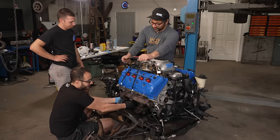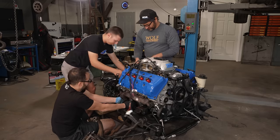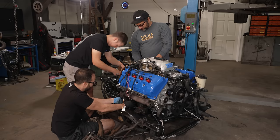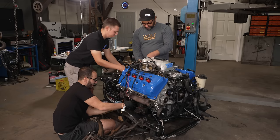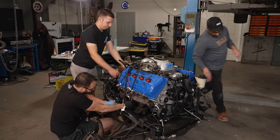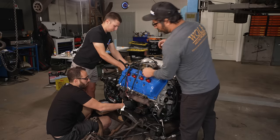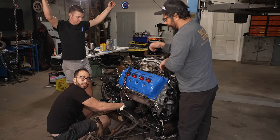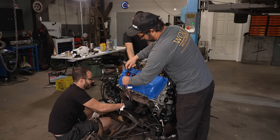So fun fact about four valve starters, that's this guy down here. They have three bolts to go in, and in the factory service manual, if you are a Ford tech, they tell you if you have to change the starter, or like if you put a set of headers on at your house or whatever, they tell you not to put the top bolt back in because you cannot get to it.